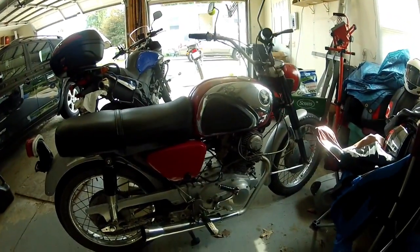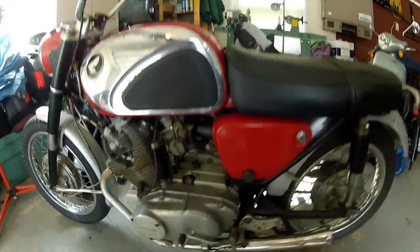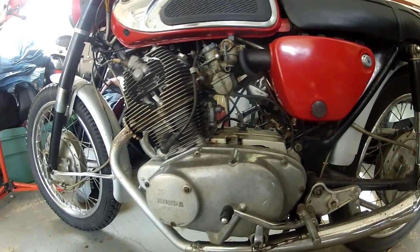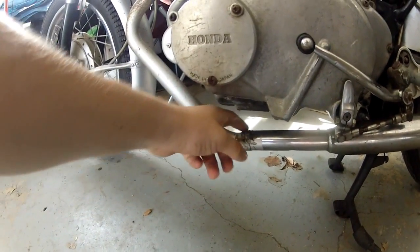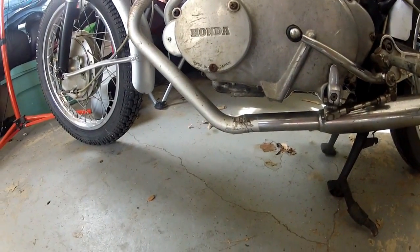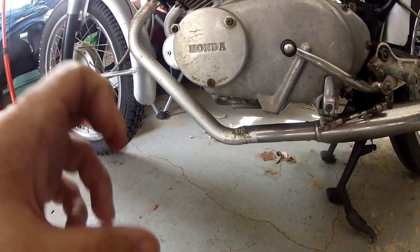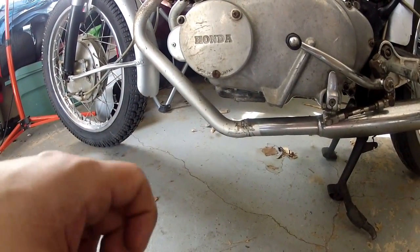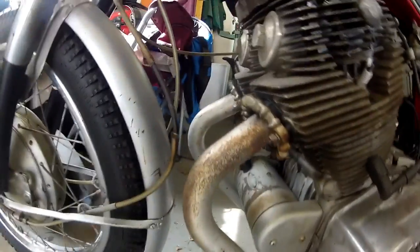I haven't checked the airbox yet — I'm sure the air filter will need to be replaced, and I wouldn't be surprised to find mouse droppings inside. I did find that on a CB125 I rebuilt. Down here the muffler itself is cracking, so I'll need to pull that out and see what I've got. It may be as simple as wrapping some seal around it — you can use JB Weld or metal strip with high-temp RTV and a clamp to fix those holes.